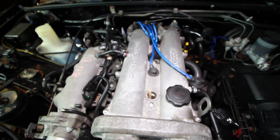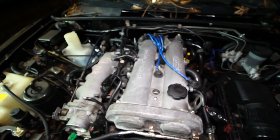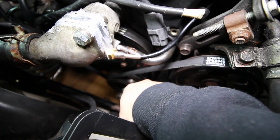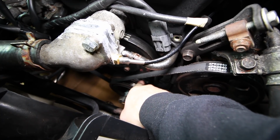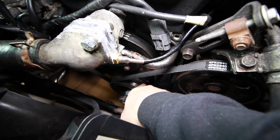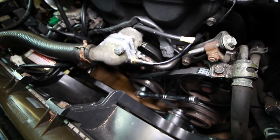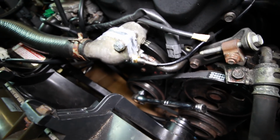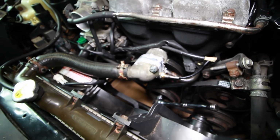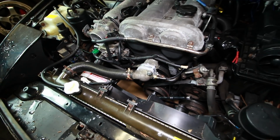You can also visually inspect the top of the chamber and see that the piston top is there. You'll see that you have notches that correspond to 10 degrees before top dead center and then top dead center. You're going to want to mark it visually to make it more obvious, so something like whiteout would help here. Just for reference, each mark on this little timing guide is 2 degrees. So you have top dead center, 2 degrees before, 4, 6, 8, 10, and so on.